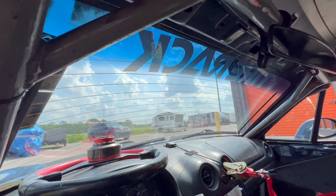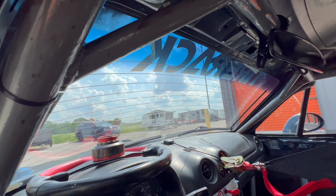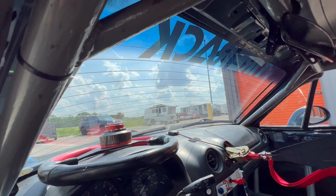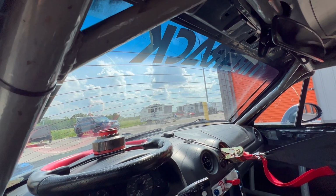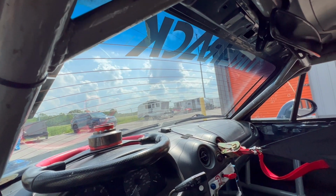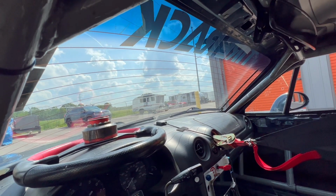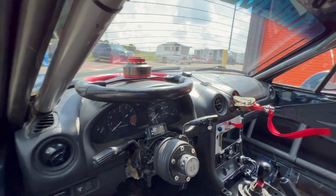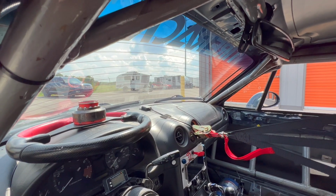We did the, oh man, I should look this brand up. If anyone's curious about this window defogger system, it sucked to install. But I guess I haven't used it yet, but one of our drivers says it works wonders, and I don't doubt it from the videos I've seen that he's posted. It's basically just what normally goes on your rear glass. It's a kit, so you can put it on your front glass, and then there's just a little switch that turns on a relay here, and it's on switched power. So I'm excited to test that if we need it.